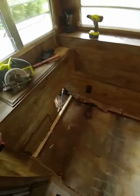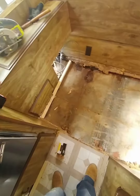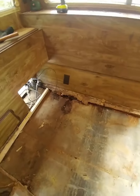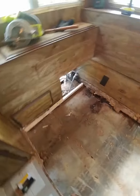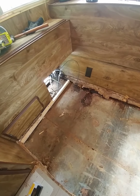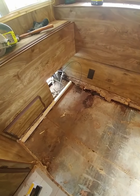I wound up taking the whole floor up — every time I looked, the whole floor was pretty much destroyed. I'm laying one 2x4 and eight 2x2s, and then I'm going to insulate it. Not with the standard batting — I'm going to use foam insulation because that other stuff gets so stinky and wet and damp. I think it's going to go pretty good.